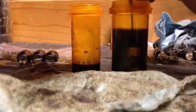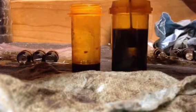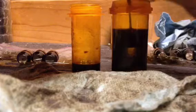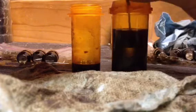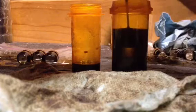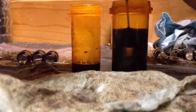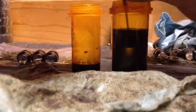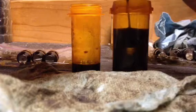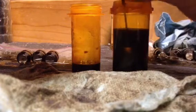This is the trick when you're going to put these back in the car — you want to make sure that you get all of the air out of the lifters. See the air bubbles shooting right out of that. Right now I have this one pretty much drained; it's going to basically flush out all the garbage inside this lifter. You can see that oil is just getting dirtier and dirtier. I'm probably going to have to change it on the next set of four that I'm going to clean.